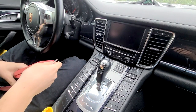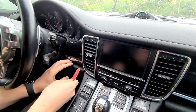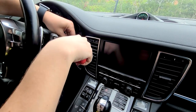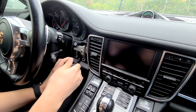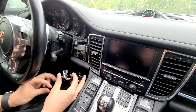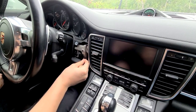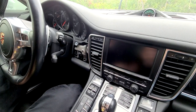We have to remove these two side vents, so first we're going to start from the driver's side. We're going to use our panel removal tool and get underneath here and kind of pop it out. Once you remove this panel, you're going to see there's one connection with a clip on it — you just click it and it unclips. There's a metal clip that may fall out, which is why I mentioned the magnet earlier. You just find where it fell from, put it back, and you're good to go.